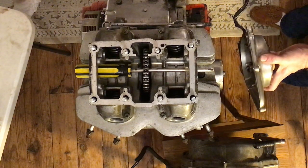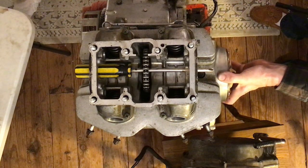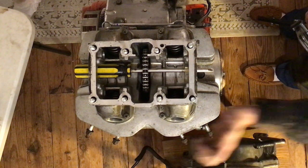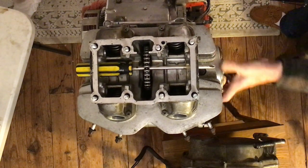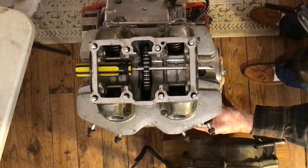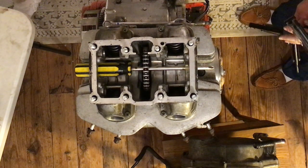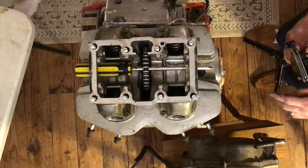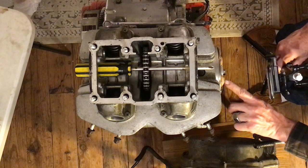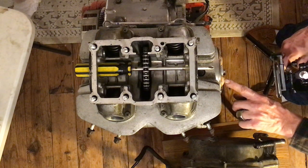The alternator cover — just put this on and tap it in place. We're not screwing anything in; we have it on here for one reason only: right here in the dead center there's a little tiny mark called an indexing mark. We need to rotate the alternator until the LT mark lines up with that indexing mark.